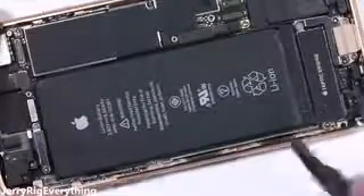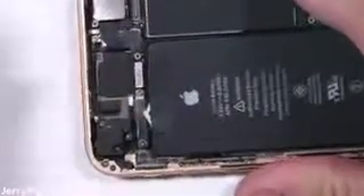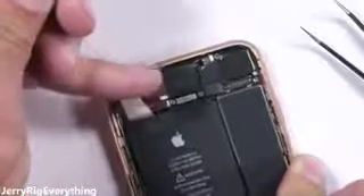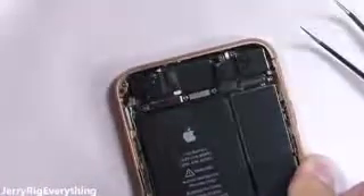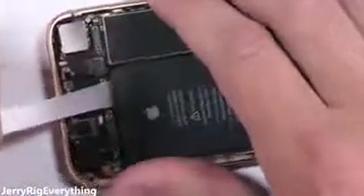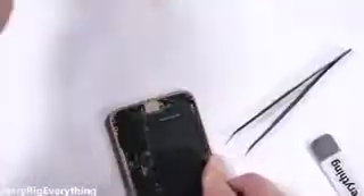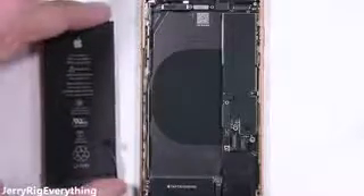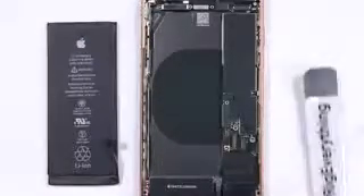It looks a bit different than usual. Instead of two magical pull tabs, we have four — which is a good thing in my opinion. If you fail on one, it's not that big of a deal. With the magic pull tabs, you grab the lip of the little black tab and pull it out from underneath the battery. As the adhesive stretches, it loses its stickiness. Just repeat the process three more times with each of the little pull tabs. These are seriously the best way to adhere a battery — no heat or violence required for removal. The four-tab method also keeps the adhesive from sticking to the top of the wireless charging, which you'll see here in a second.